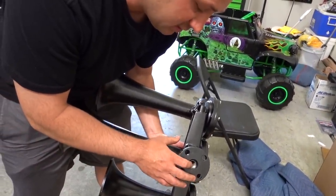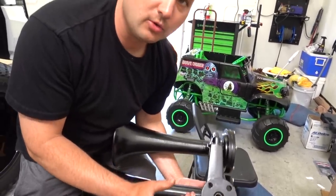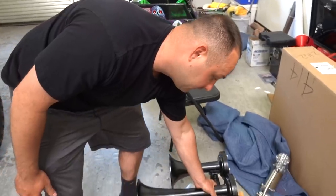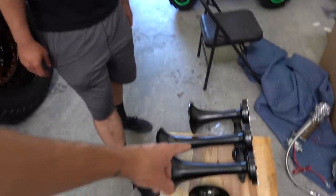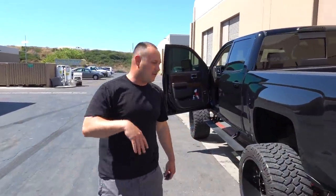We're actually going to be upgrading away from half-inch airlines. These come with a half-inch MPT inlet, but we're going to go with half-inch MPT to three-quarter inch air tubing - a three-quarter inch dump valve from the tanks along with three-quarter inch line. With these horns you need sheer volume of air - high pressure but volume. I've never run one on three-quarter inch line, all mine have always been half inch. Let's test this one on half inch right now to give a comparison for anyone setting up horns on their truck. We're at about 140-150 PSI.